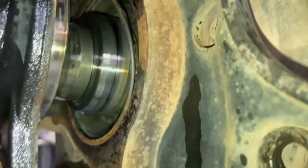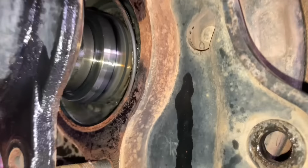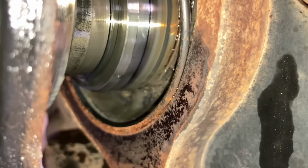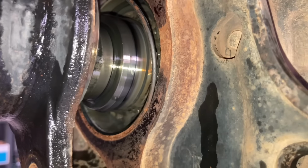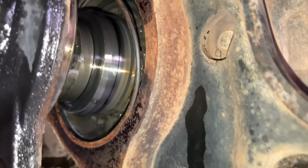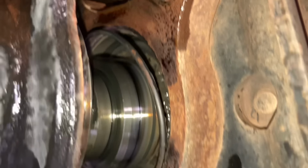That's not good. So these wheel bearings have been replaced. They're not that old. They've probably done about 100,000 Ks max, probably less. I'd have to think hard to work it out. It looks to me like some oil's got past the seal to the bearing, and what it does is wash the grease out, as you can see, which doesn't mean this bearing's noisy. Normally a bad bearing is more of a rumble, which I don't think it was, but because I was thinking in my head the bearings are done, it's not that, it's got to be the diff. So I could be wrong about all this.